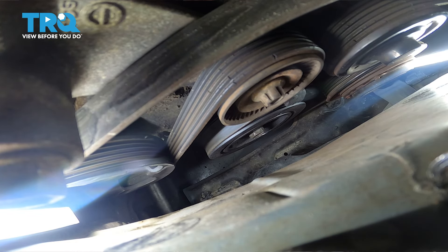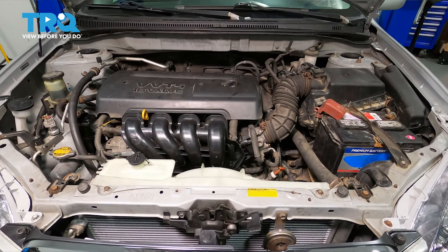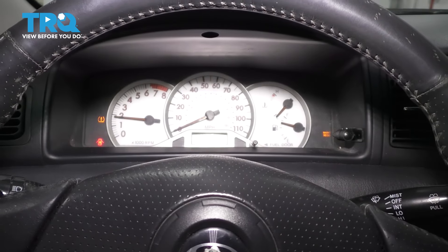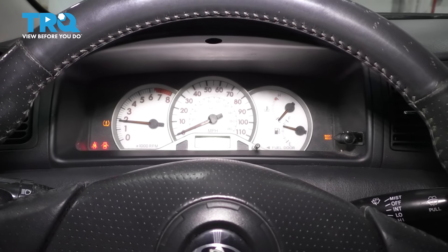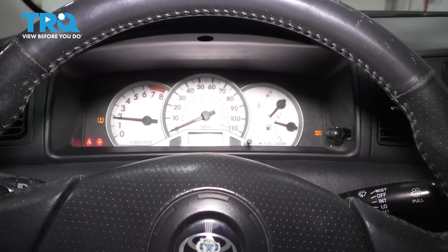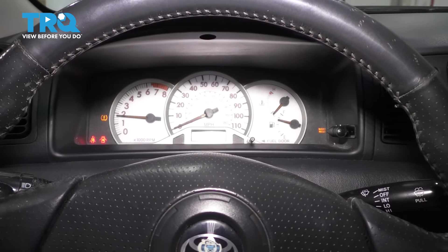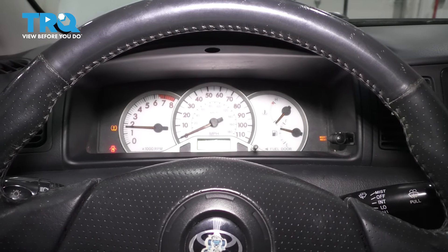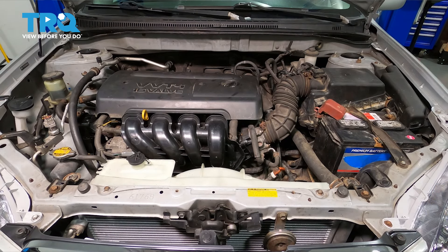I went a little bit further just to make sure that everything spins freely and it does. Now all we have to do is start up the vehicle. If you heard that slight rattle on startup, that's normal — it's only because the new tensioner has no oil pressure built into it. For a couple seconds it's going to rattle, and then it should never happen again. It's only on the first startup after you install it. Everything seems to be running very smoothly. I'm going to shut it down and take it for a road test. That's how you replace the tensioner.